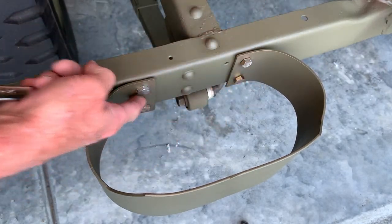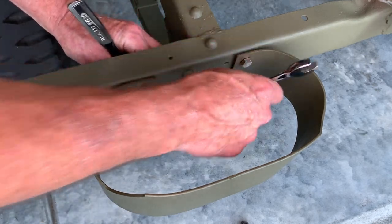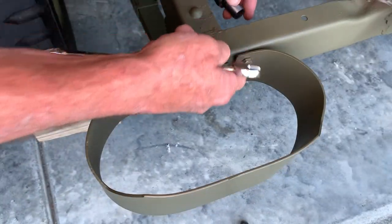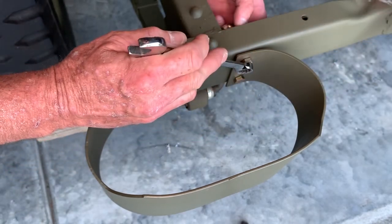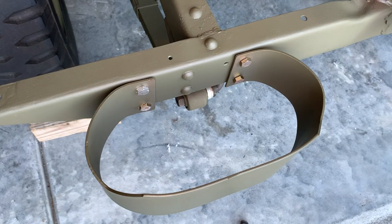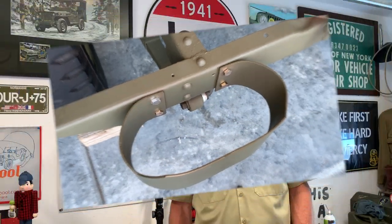Notice how this is pulling in nice and tight. Look how loose that bolt was and how nice it lined up. There again, back across as an X — top bottom, bottom top. Go ahead and tighten that last one up. Before you tighten these bolts fully, walk outside your Jeep, look from behind, make sure you're happy with how square your bumperette is, and then go back and tighten them fully. Hope this helped you out. That's how the bumperettes go in — and we love that spring steel. Look how nice that looks. And that's it — we got it installed. It's the same for both sides.